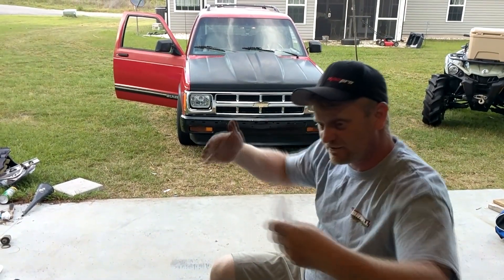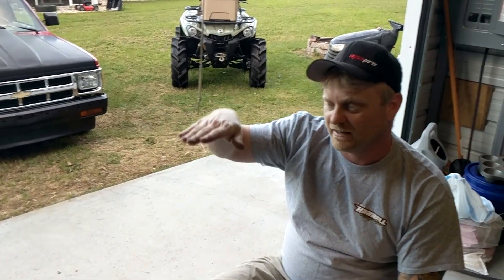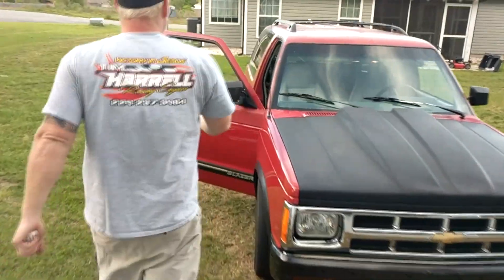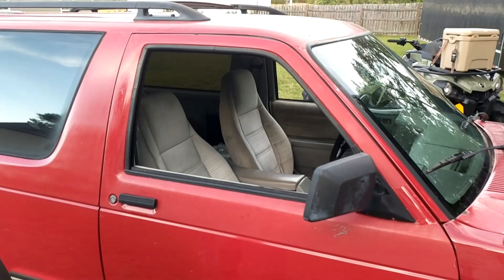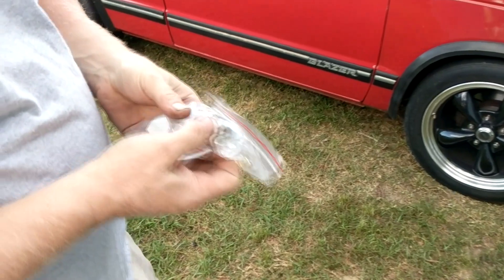Before we rip off the front end, we want to put new door pins in so we can hang the fenders and the front end back on in front of the doors. We'll have a good steady reference line for the fenders. We want to get our door gaps and quarter panel gaps fixed up. As you can see right here, the gap is way too wide — the door has drooped here and here. We want to get the pins in, pick the door up, and twist it back to where it needs to be, so when we put the fender on we have a solid reference. The driver's side door droops more than this one — pretty common problem with these old Chevys, even up into the 90s.